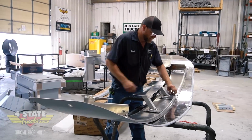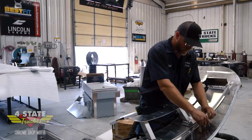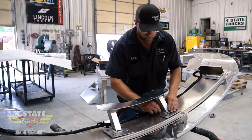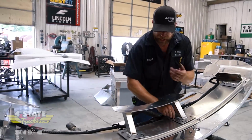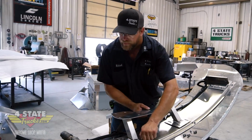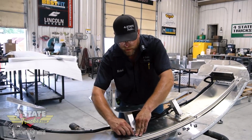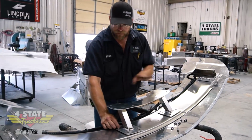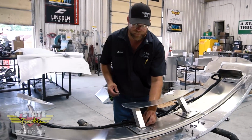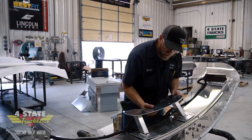So what I'm going to do next is actually kind of disassemble this visor and take this center bracket here and lay this out on the roof and get it marked, drilled, and actually mounted with a gasket underneath it, of course. But I'll have this mounted, then I'll bring the rest of the visor up to it to lay out these end ones. This is just too many pieces and adjustments and variations to try to lay out all my holes at one time, even with two people helping you hold it up while you're drawing on the tape.